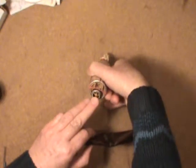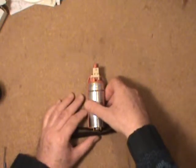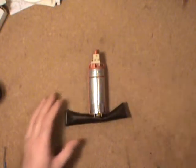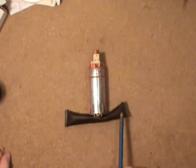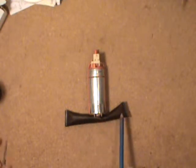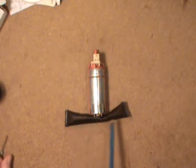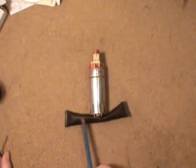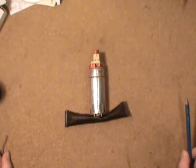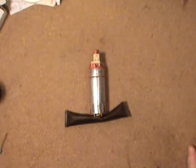What I have here is a filter sock, and there's the inlet for the fuel when it's sitting in the fuel tank. The orientation when installed in the tank is like so — here's the bottom of the tank. This filter sock is made out of a nylon type of material with a really fine mesh. It's not as fine as an inline fuel filter, but it filters out most of the stuff that's too coarse to go through the pump.